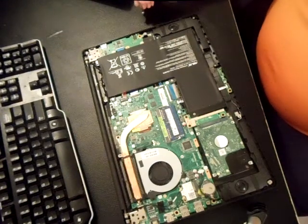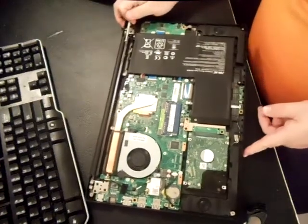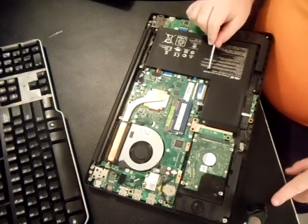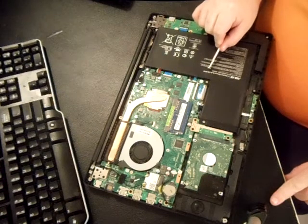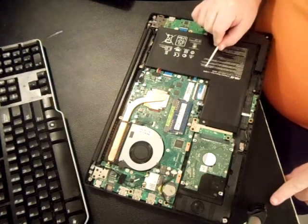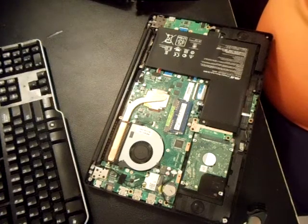You can see here it's got a gigantic battery. This looks like it's a non-removable battery. Whenever you watch this video and need to replace the battery, the best thing to do is pull the model number off the battery. This particular one — the model number you'll see on the top right — is C41-N541. You can get it on Amazon or eBay.